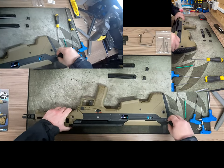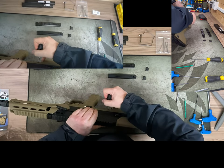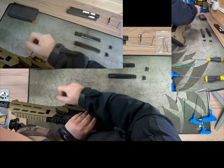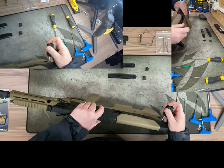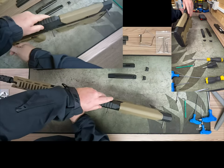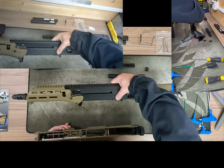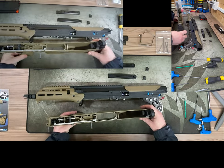We're going to push those push pins out now. It's easier if you give yourself some room and push centrally — one, two, and three. Just make sure they're pulled out to the point they click. If they come out in your hand, you can just push them back in — not a big drama. That then separates the upper from the lower.